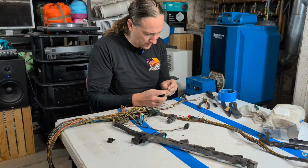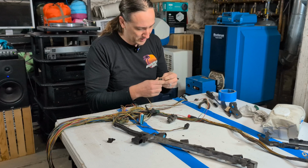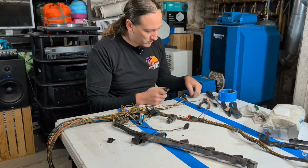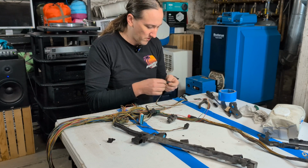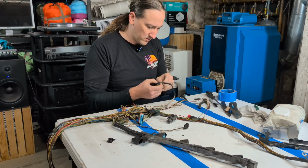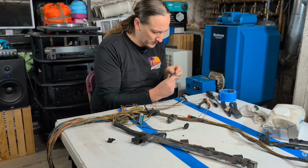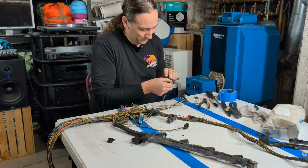The Megasquirt unit I have, like many Megasquirt units, has an internal map sensor. And there's a vacuum line that comes directly out of the ECU case. So you just run a vacuum line to your ECU and you get a map sensor that way. I don't know that that's the best design. It kind of feels like going backwards these days, but I mean, it works.